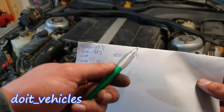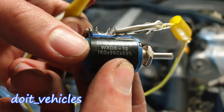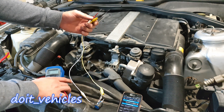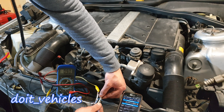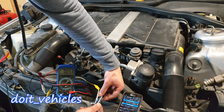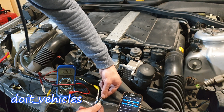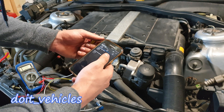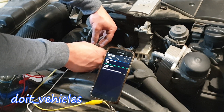Now for the last test. I've got a potentiometer with a maximum of 1000 ohms, with connectors in the right position. Let me verify it with the voltmeter — I can increase the resistance up to 1000 ohms and decrease it down to 0. I'm going to start from 1000 ohms. You're going to need needle connectors for this. I'm going to go to live data, unplug the sensor — it goes to minus 40 degrees — and connect the potentiometer.